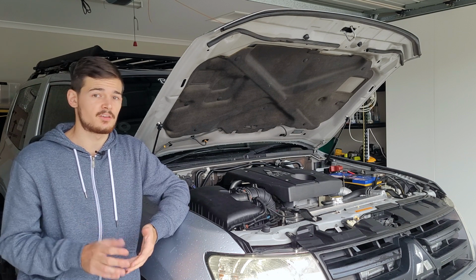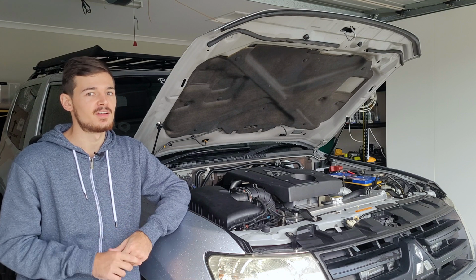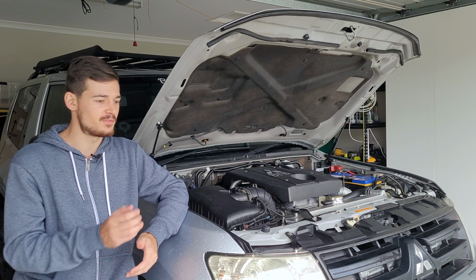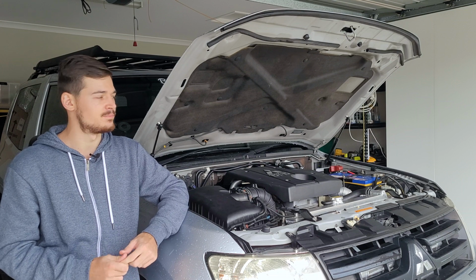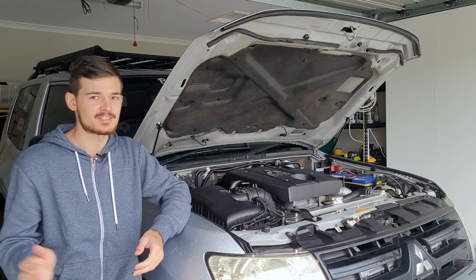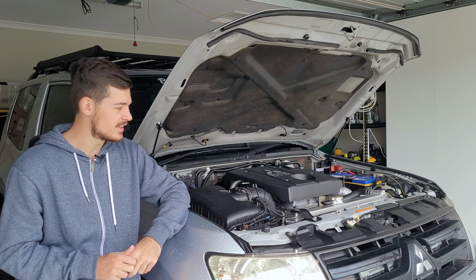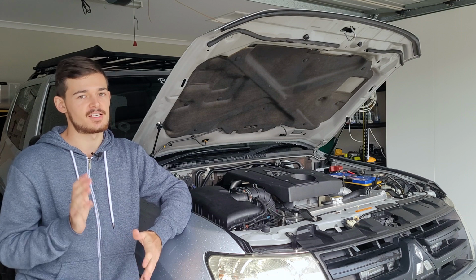And then the second thing, of course, if you're going to drive off, then you're going to be unreliable. There's going to be black smoke and you don't have the tools in your car all the time just to fix a quick pipe that blew off. And maybe that clamp can, I don't know, ruin your engine or something, like breaking a fan if it goes that way. So there's just too many things that can go wrong. So definitely do this before your dyno tune, or as I said, just in general.